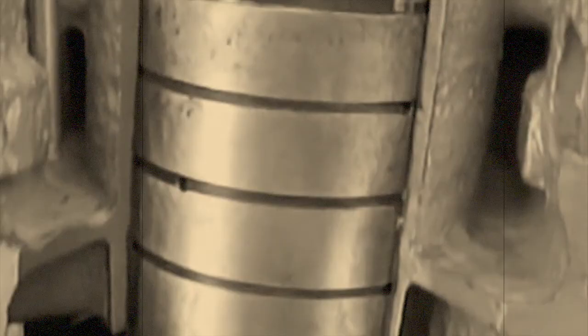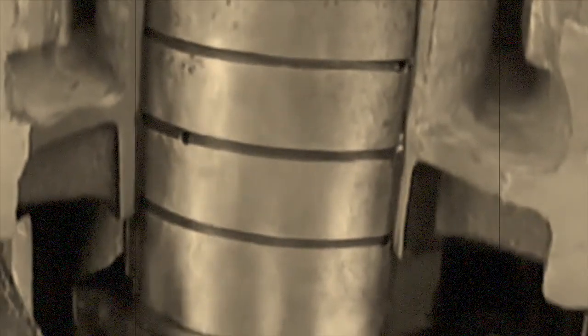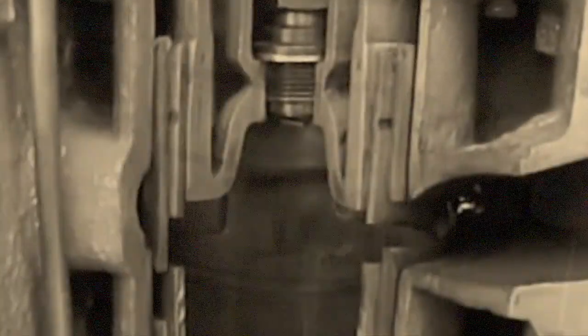The sleeves are operated by small connecting rods actuated by an eccentric shaft and have ports cut out at their upper ends. The cylinder head, known as the junk head, is like a fixed inverted piston with its own set of rings projecting down inside the inner sleeve. The design is remarkably quiet and the sleeve valves need little attention.